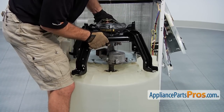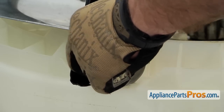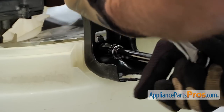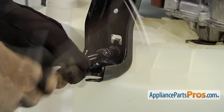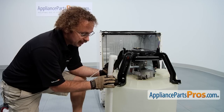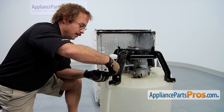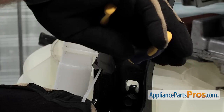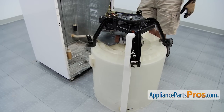Line up these bolts with the metal retainers behind the tub. Now that we have it in, we can put the bolts back in. We're going to use our half-inch socket again. Next, we can re-zip tie the overflow tube back to the leg. Take our zip tie, put it through there, wrap it around, and cut it off. Then we can take our needle nose or dykes and cut the excess off. Now we can put the assembly back into the machine. We're going to rotate it back in the same way we took it out — it's pretty heavy, so get somebody to help you.